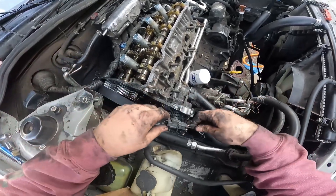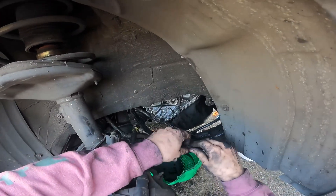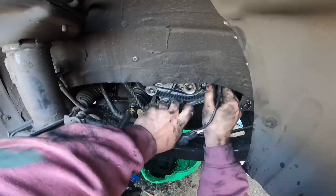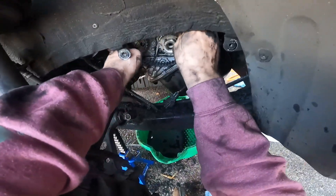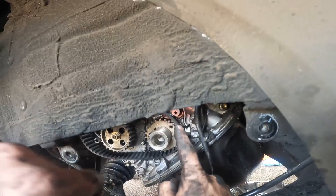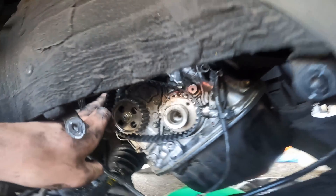First, I need to put this sensor back in place. I'll take this sensor, drop it back down, clean it up a little bit. Anything tightening into aluminum does not need to be crazy tight — get it on there snug. Make sure you route the timing belt the right direction. The timing belt goes around here and up underneath this upper pulley, so make sure you definitely don't route the timing belt the wrong way.